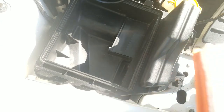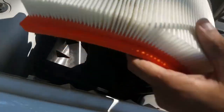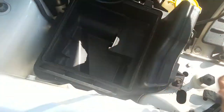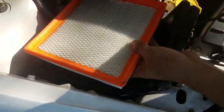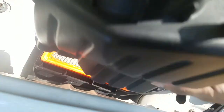As you can see, our airbox now has a big huge hole — we can suck all the air we want into the throttle body. Now we get the air filter. If your filter is like mine, it's pretty much brand new with 600 miles — I recommend you just put it back in. Give it a good tap on your hand away from the air intake to make sure any dust gets out. Mine actually had a bunch of leaves and somehow a napkin got in there.